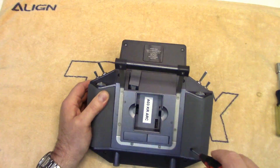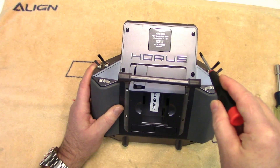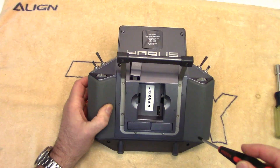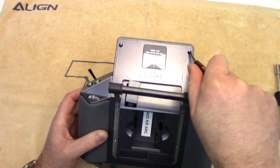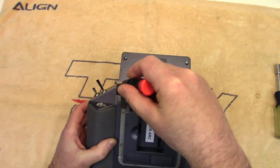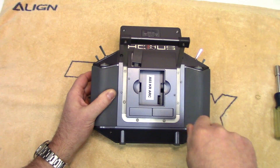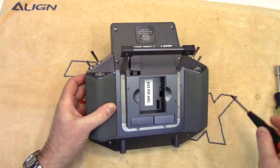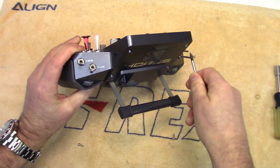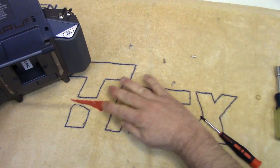There are six screws on the back to access. Battery replacement for the X10 or X10S will be similar — opening it up will be different and the location will obviously be different, but the same principles would apply, probably even for the Jumper T16 and the T16 Pro. There are six screws: two in the top, two kind of in the middle, and two at the bottom. Once they're all loose, hopefully the back will just pop out. Make sure they're all accounted for — there's all six.